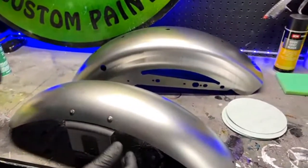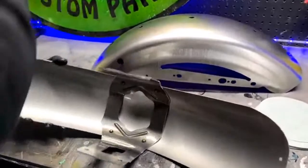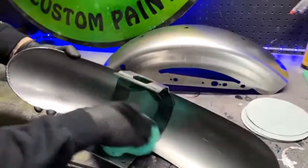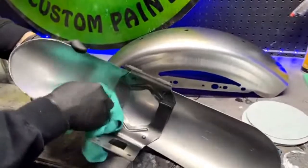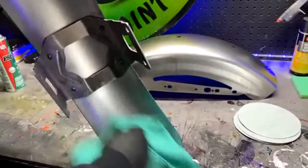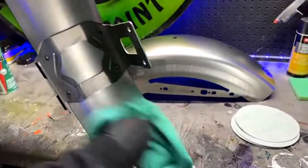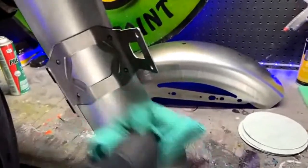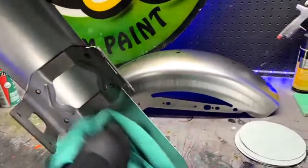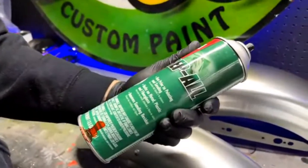Okay, that looks great. Someone said, is the degreaser specifically for automotive or does it matter? You're always going to want to use automotive stuff pretty much on everything. That does not include O'Reilly or AutoZone. Their paint section is not good either, unless you're buying Scotch-Brite or maybe even Bondo. Don't buy their base coats or clear coats or anything you put in the gun. How about lacquer thinner? You could buy lacquer thinner there, but cleaning with it? I don't think I would. It'd probably work, there's just better stuff. The stuff we're using here is made for this purpose.